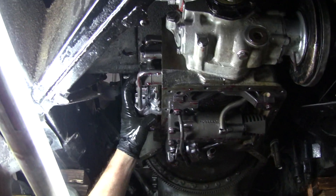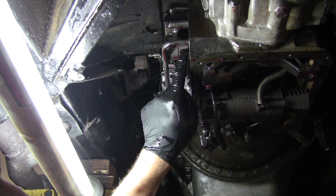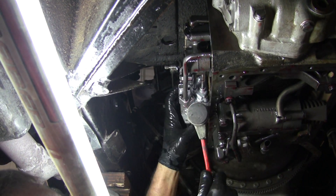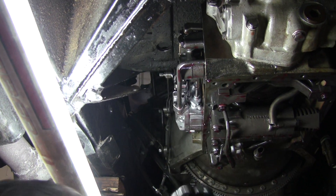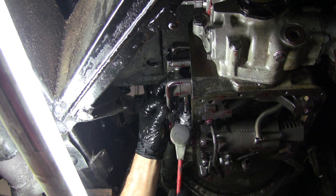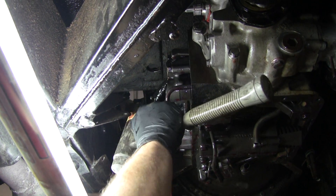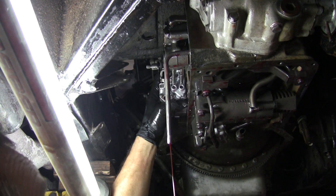This thing I can't pull out without taking this out first. It has two tubes going back to the governor that send the governor pressures — there are two governor pressures. So I gently tap it forward, and usually this tube falls down and dumps fluid all over me, so I'm going to try to remember not to do that. There we go, just like that. It usually gets me.